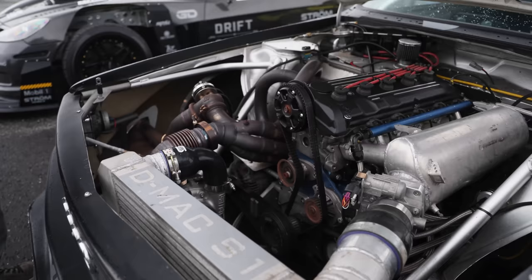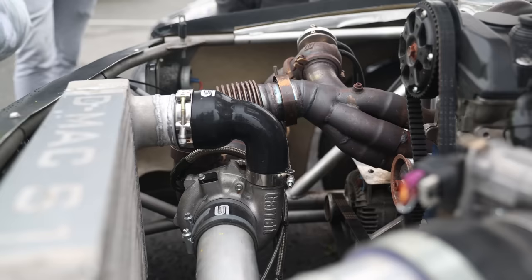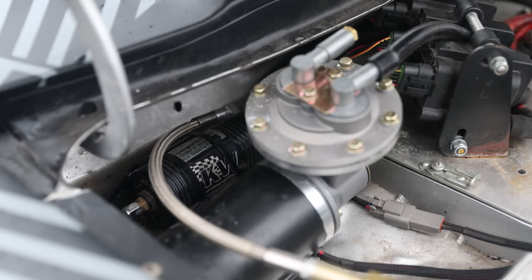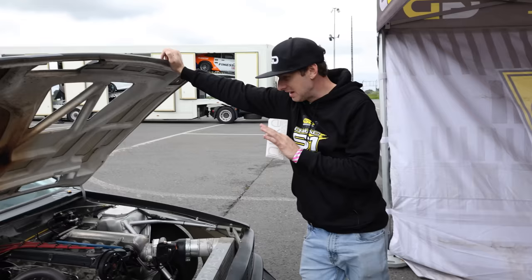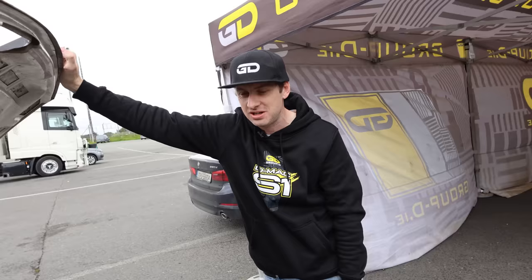Can we take a look at the engine bay? And I'm assuming nobody else has done anything like this — there aren't really any other famous Audi drift cars, because this is just so difficult. I think there's one in Hungary that looks like a UR Quattro, but I don't know what engine is in it. It is a drift car, but it's rear-wheel drive. We moved the engine back because originally it sits out front almost in the bumper — they're like 63% nose weight, which is not going to fly. So we moved it back about 18 inches.